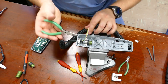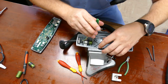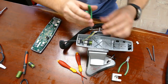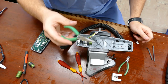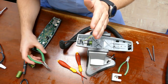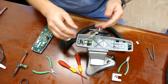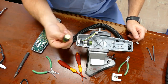Same thing I did before — take a needle nose, stick them at the base of the capacitor, and bend the wire over to the right just a little bit. The reason we use the needle nose at the base of the capacitor is because you don't want the weak point — which is the exit of the capacitor — to be where it bends. You want it to bend out a little bit so it doesn't stress and eventually break like it did with these.